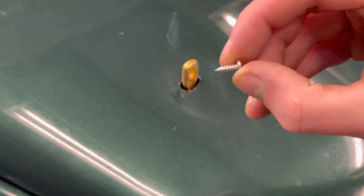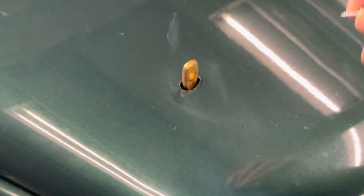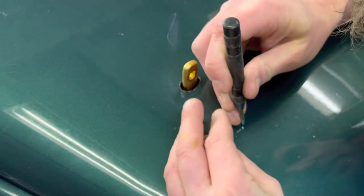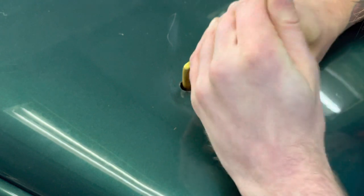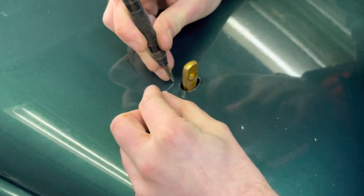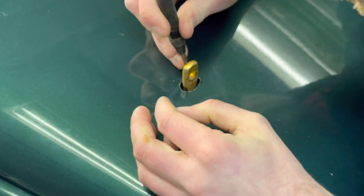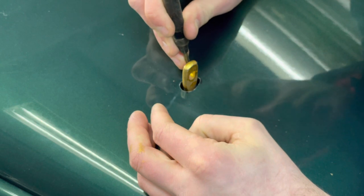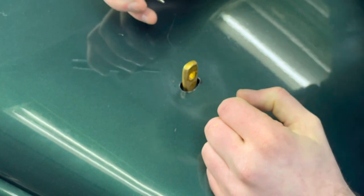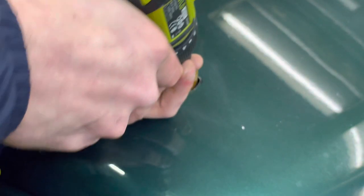These screws that I'm using are pretty tiny, so just a wee little drill bit. We'll just tink, tink, tink. Give them there. Don't forget to centre punch these. It makes a nice difference when it comes to drilling these holes as nicely as you can. There we go. That should stop the drill bit from wandering.